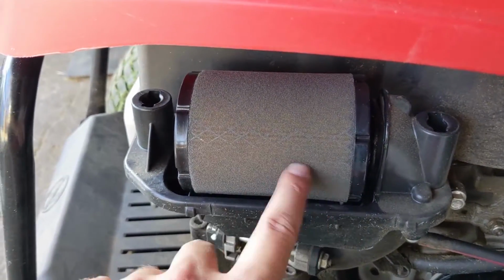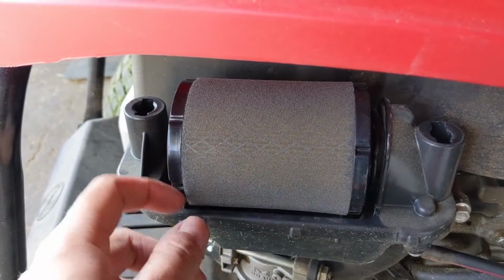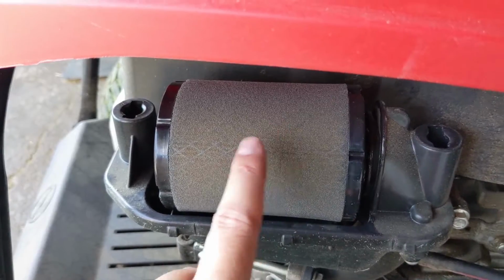Again, this is silicone grease, so you could imagine that customer that put it on the pre-filter thinking, hey, that's going to be some type of grease to catch fine debris. It would hardly let air through. So in that case, we ended up ripping the pre-filter off. We couldn't wash the stuff out. It was real nasty.